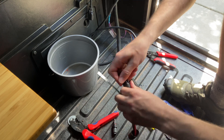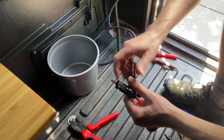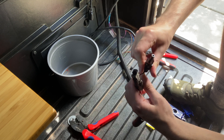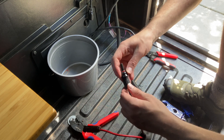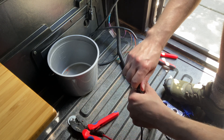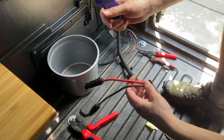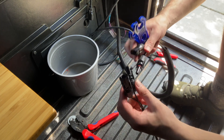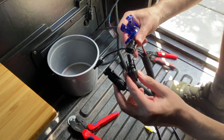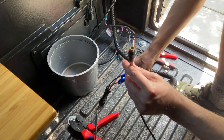On this one I can do it by hand. For the male connector, same process - slide this on, push this on until it stops, and then tighten it. My connectors came with tools to tighten, but this one was pretty easy to hand tighten. You can now see that the red wire is going to positive. Connect this to the battery once the solar panel is on top.